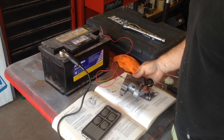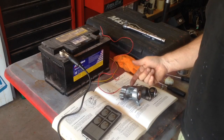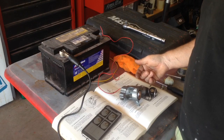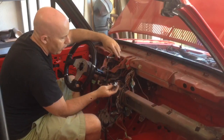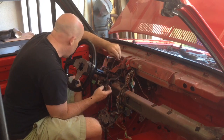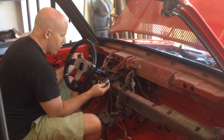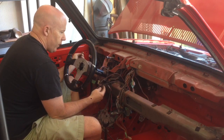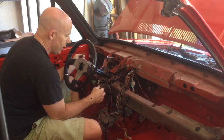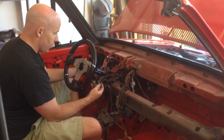And that's probably why the previous owner, Jerry, rigged that start switch and fuel pump switch. At least this is why the starter wasn't turning over. Now I just have to figure out why he wasn't getting power to the fuel pump. Back inside the car — this is the switch that he was using to activate the fuel pump. I did get the car to start using this method. So now what I'm going to do is just trace these wires back so I can figure out where the hot wire to the fuel pump is, and then I can make sure that I have power going to the fuel pump when I reinstall the proper ignition switch.